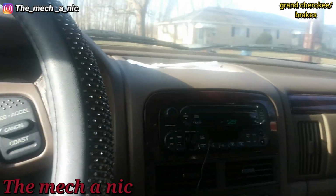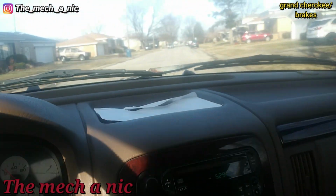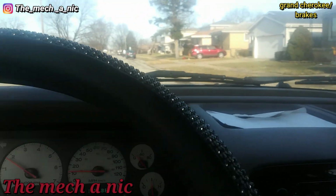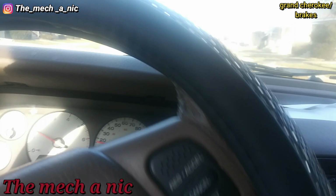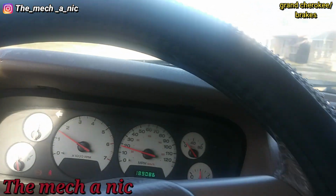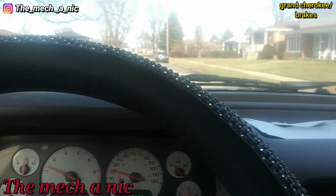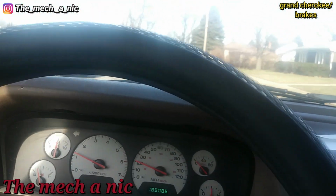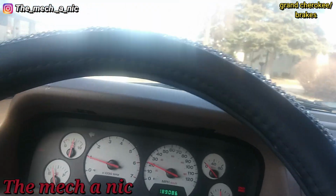she said if you get on the expressway with the car, the front end just wobbles like crazy, like death wobble. But just driving very slowly around the block here, I could feel there's something wrong with this alignment, the suspension, something. There's like a 3-inch play in the steering wheel that equates to nothing at the wheels.